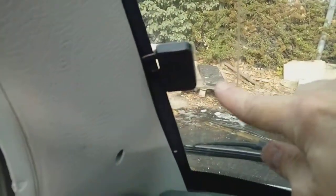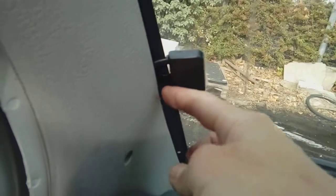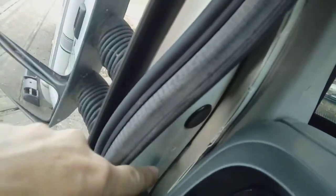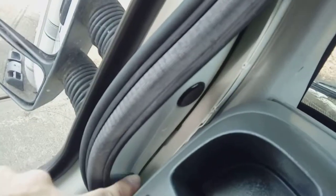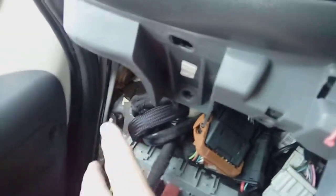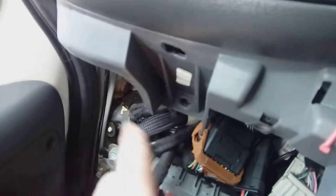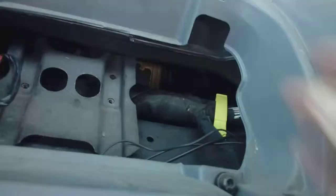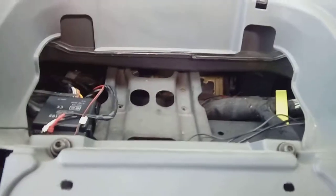And there we go — that's our aerial. So it starts here, sticky back like I was saying, sticks here, earthing point around the side here. We've put the trim back on, put the three screws in, pulled the door seal away slightly so we can run the cable down the edge here. We're going to loop it round under here, up through — because we've removed all this to gain access it's nice and easy to do — up above this, and then up here and through. And that's how we're going to run the DAB cable part of it.